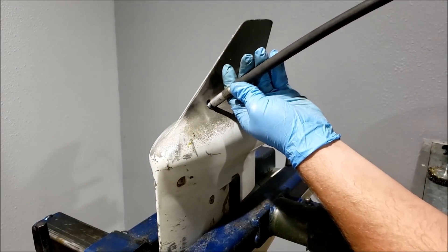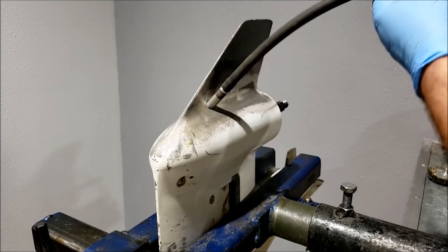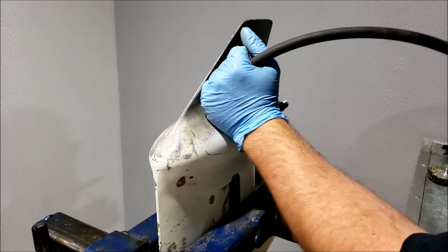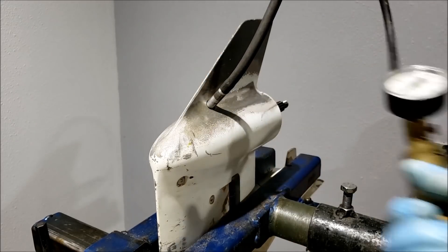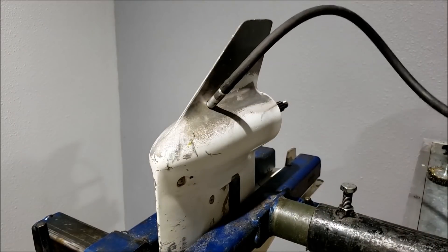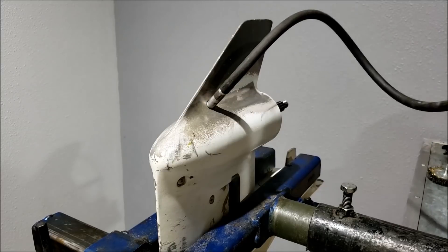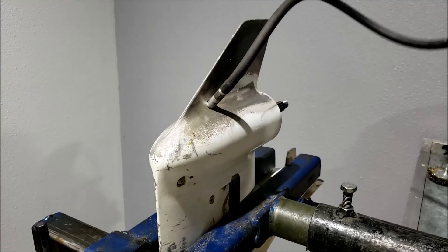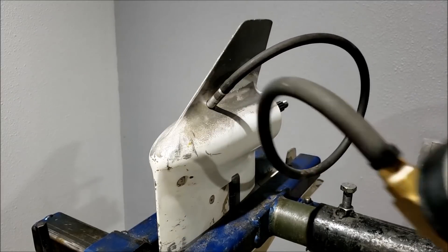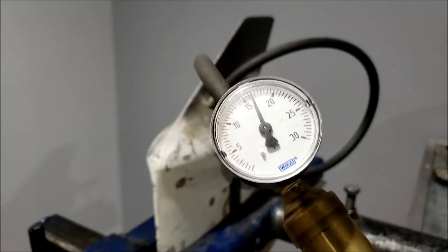The lower is drained with no water and metal shavings coming out, so that's a good sign. I'm going to pressure test it — be my pressure test here — see if it holds pressure for a while. If it does, we will continue on with our revival. I'll let it sit there for a while, go do some other stuff, and see if it drops.